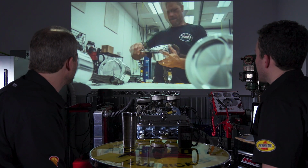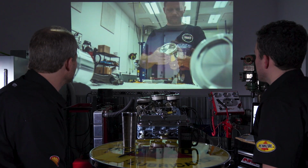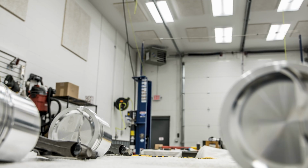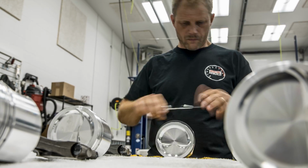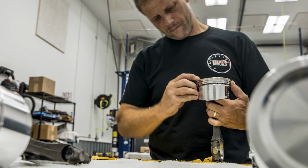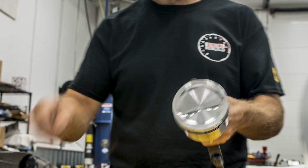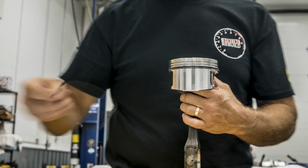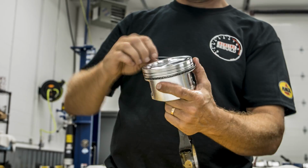All right, so you have that done. Next step is to finish the assembly on the rods and pistons, putting the rings on. Put on your oil control ring, which is the corrugated looking section, and then there's an upper and lower relative to that, and then your secondary ring. All right, there's a good view of it there.